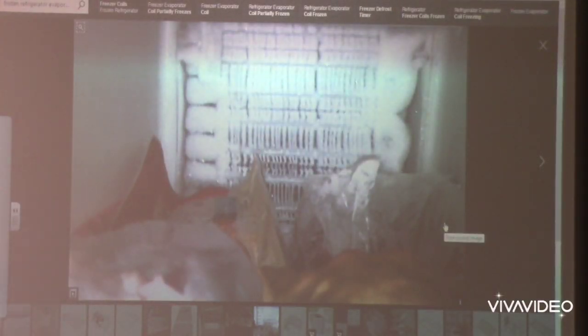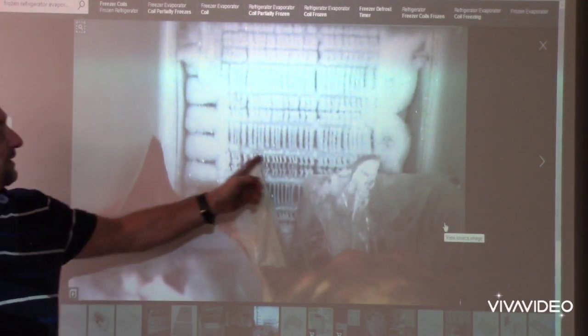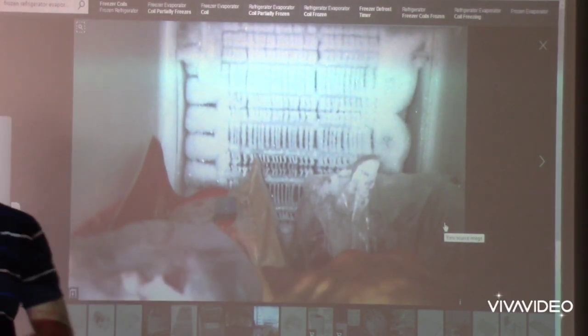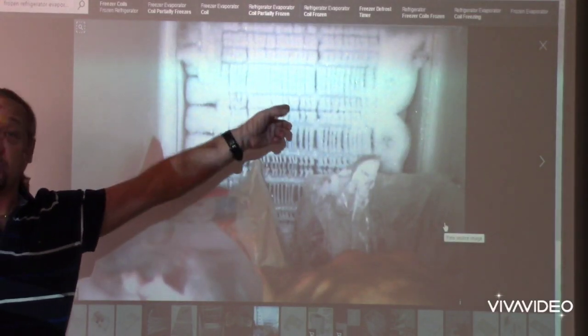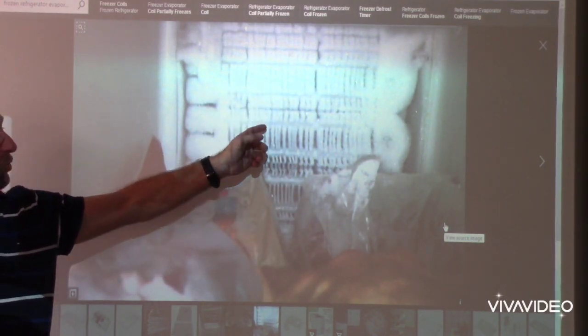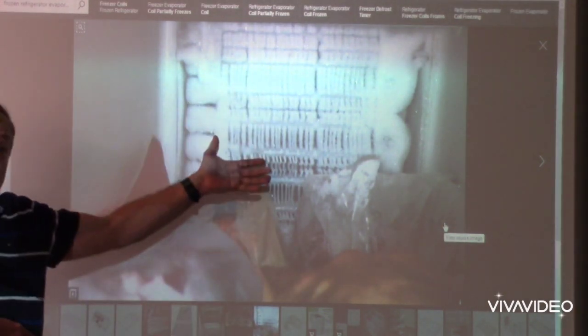There is an evaporator there completely frosted up. If you go into someone's house, you might see a little bit of frost, but it's just a very light coating. If it gets any more than about an eighth of an inch thick or as thick as you see here, the refrigerator's not defrosting. Usually by the time the customer notices, the freezer temperature gets so warm the food is spoiled. But because the tubing itself is so cold, even though the food is melting in the freezer, the ice is not melting because the tubing underneath all that ice is 15 degrees below zero. So when a customer calls you out, there's a panel over this and that ice may even be on the exterior panel — you might not even be able to get to that evaporator.